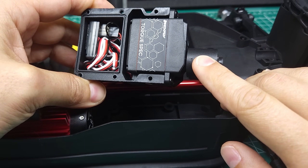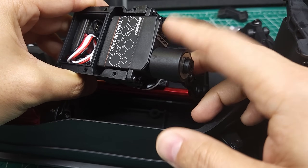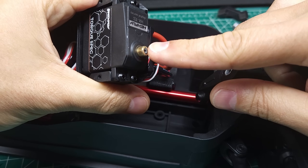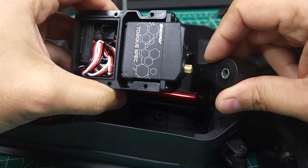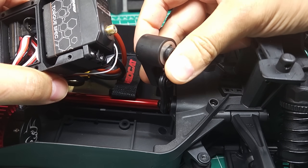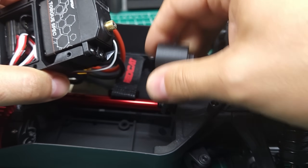There is some concern about wear over time as there aren't any bearings in the steering — it's just sliding in the chassis itself. The servo is mounted to the bottom of the ESC mount. This is a standard size servo; however, on the Wav Racing it was a 23-tooth servo saver, and that servo saver was proprietary to the chassis. Fortunately, this is a standard 25-tooth servo, which means you can upgrade it to whatever servo you want — a really nice change from the Wav Racing. The servo saver looks pretty decent; while it's not adjustable, it does have metal inside and is actually pretty well sealed up.